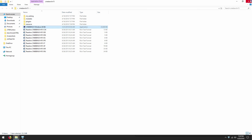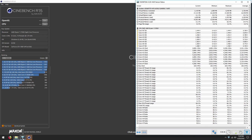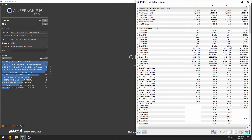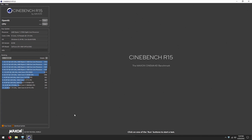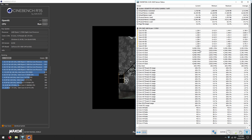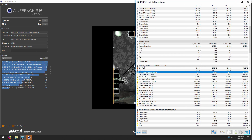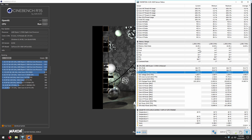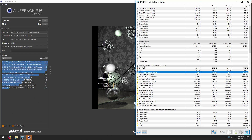Let's go to Cinebench real quick, open it up and make a run. This is the second time doing this video. So one of the things is the frequency — we have frequency without the PBO option enabled. It's around 4050 MHz more or less. Pretty much the core voltage on this load is just 1.237 volts. The sensor readings are kind of accurate on Ryzen, actually pretty good. There are some posts about it.